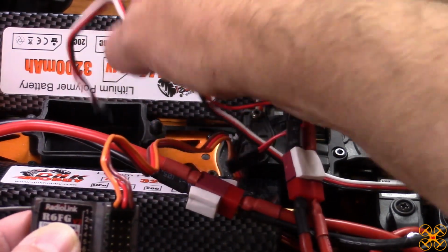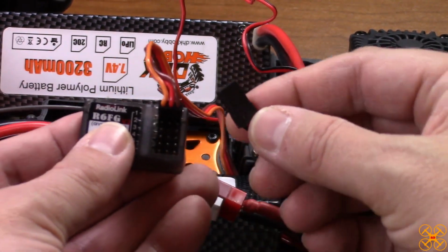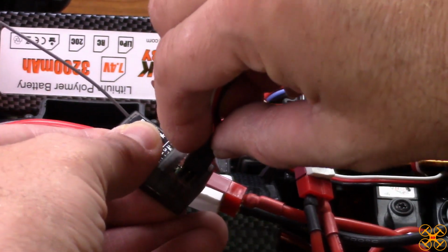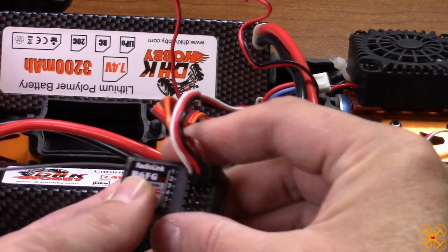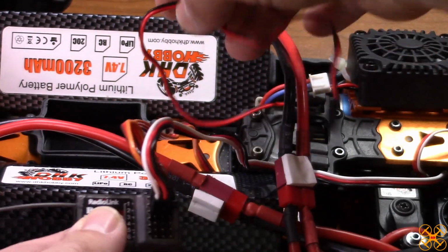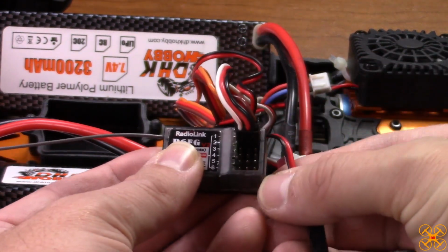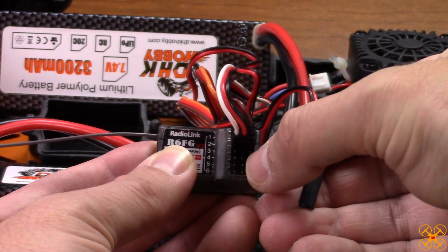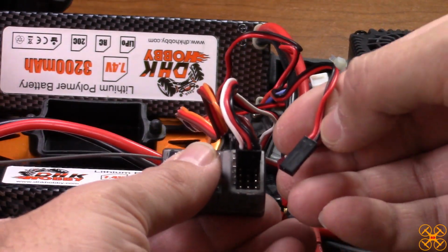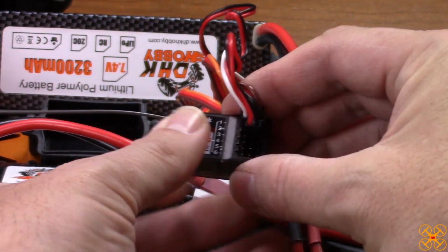And then you'll take your throttle, the on and off switch in the ESC, and that one is going to be the black wire's negative. That's going to go to the outside on channel 2 here. Let's make sure I can get it plugged in. There we go. And that looks like that is correct. And then on this particular car, this probably won't apply to yours, but I've got a little 2-pin that just powers the cooling fan. It shows you on this receiver, you've got your negative on the outside here, and then the next is a positive in the middle. So I'm just going to plug this in so that the black and red are on the outside, so we get some power to the cooling fan. All right, and that should be ready to go.